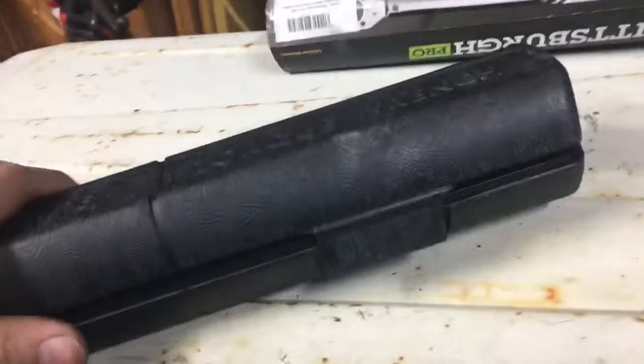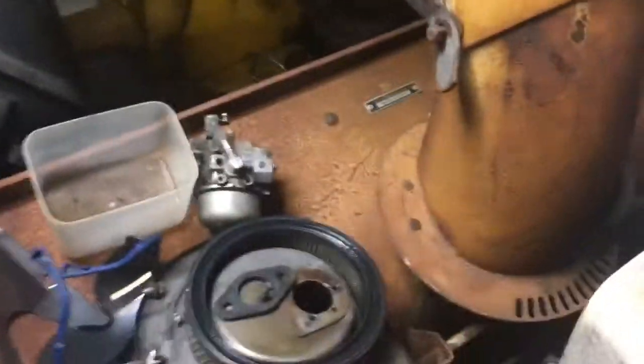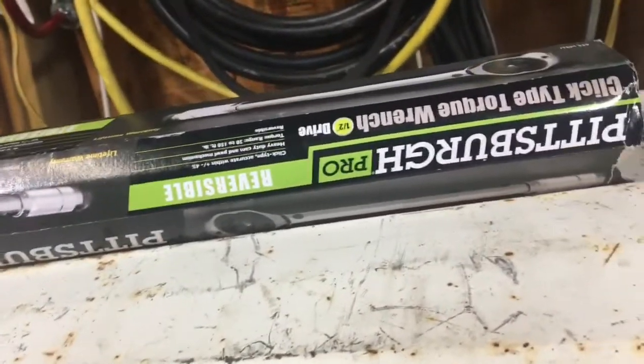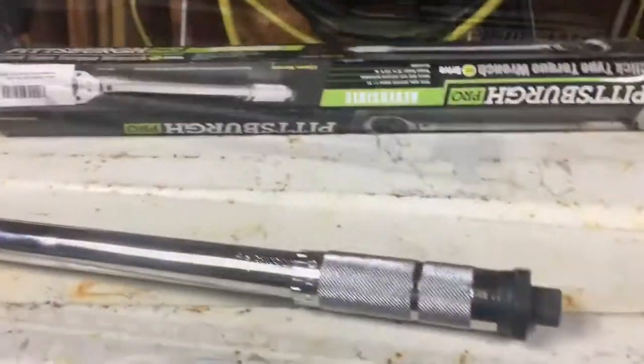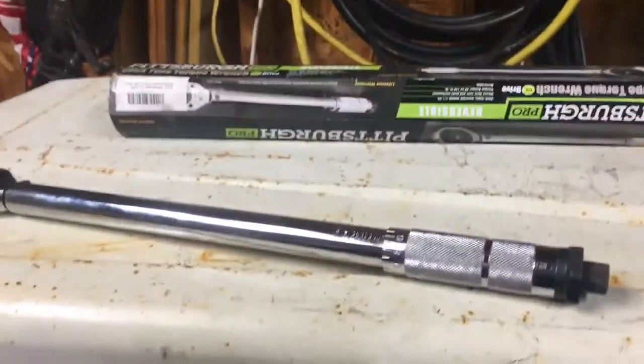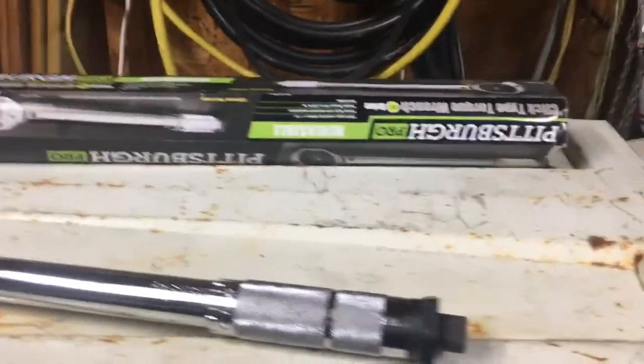For this particular engine, the torque wrench is in foot-pounds. The torque spec on this engine is 234 inch-pounds, which converts to 19 and a half foot-pounds — that's what we're going to set the wrench to. I got this torque wrench from Harbor Freight Pittsburgh. You don't have to spend a lot, but get something that works and is reliable. To find the suggested torque spec, check your operator's manual — it should have it in there, or you can find it online.